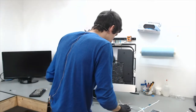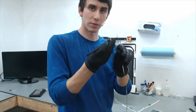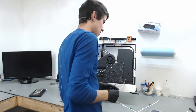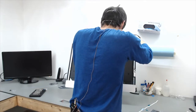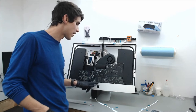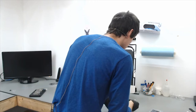The adhesive also has holes in it, and you can use a nylon black stick to align the hole on the tape with the hole on the iMac itself — that will give you a good position for where the adhesive needs to be. On a 2017 iMac there is typically a microphone at the bottom, and you want to make sure you leave it exposed so your internal microphone works.